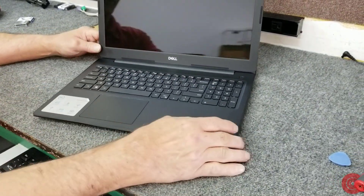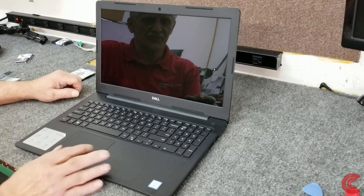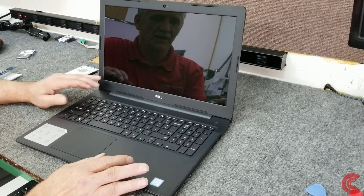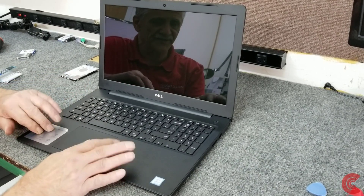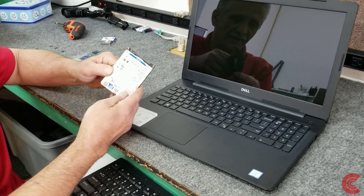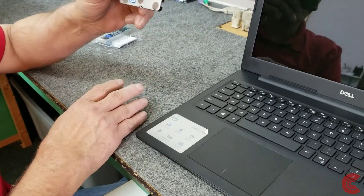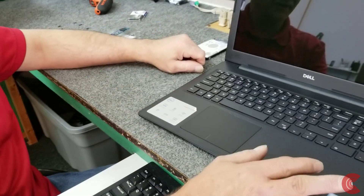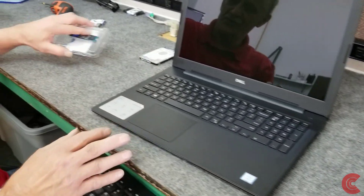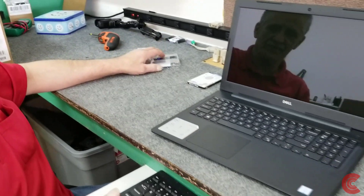So for this customer, they wanted me to do a little upgrading on it. It's brand new — I just took it out of the box — but it comes with 128GB NVMe SSD and 8GB of DDR4. I know in these models there's a 2.5 inch expansion bay to add a second mechanical hard drive in addition to the SSD. So I'm going to put in a 1TB Western Digital drive, and I'm going to take out the 2242 M.2 drive and put a 2280 250GB NVMe drive in it — beef it up a little bit for them.